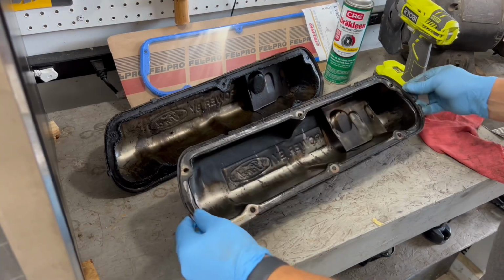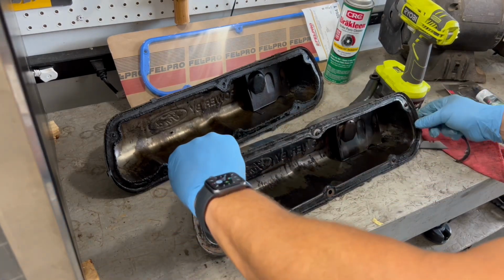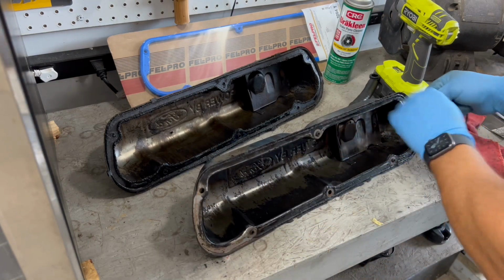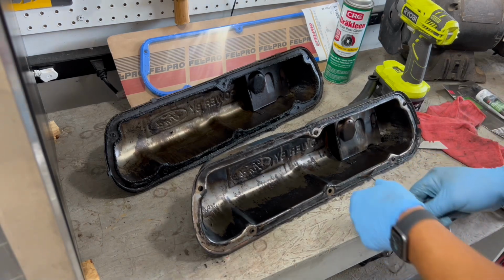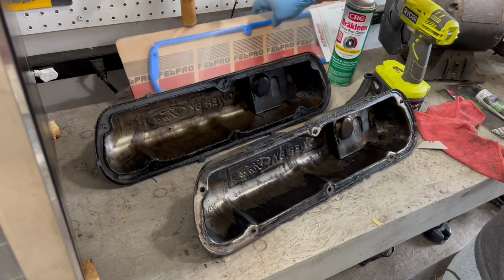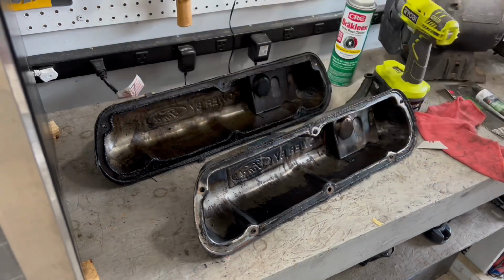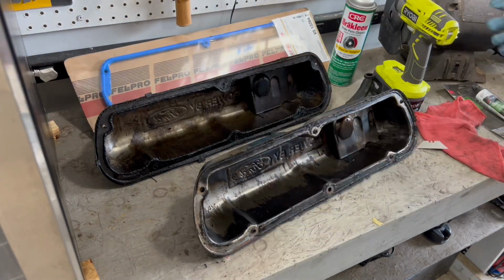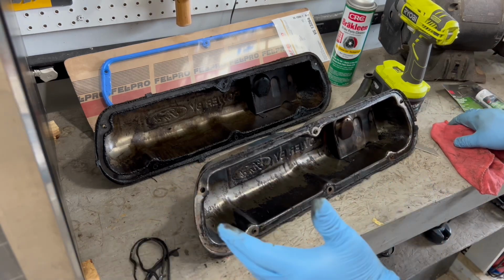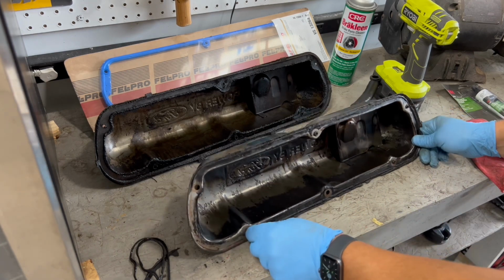Right, so I've got my valve covers out, and you want to take the old gasket material off. It looks like somebody probably RTV'd all this on. This is a complete disaster. I got a nice set of replacement valve cover gaskets like this, and it's a better route to go than RTV'ing these on. You can do it, but these things are starting to leak, and who knows when they did this. It could have been 30 or 40 years ago. This car's so old, it's all deteriorated.